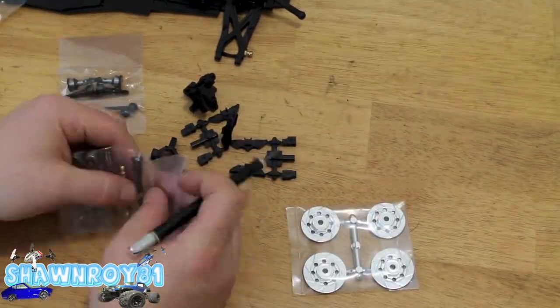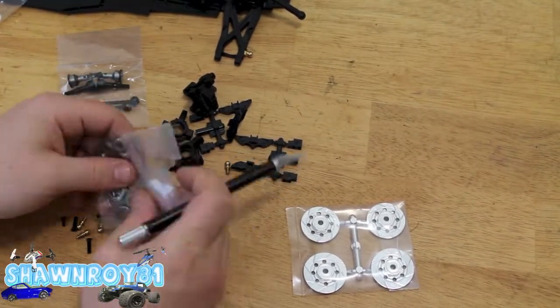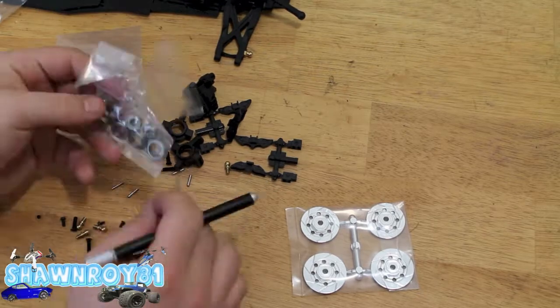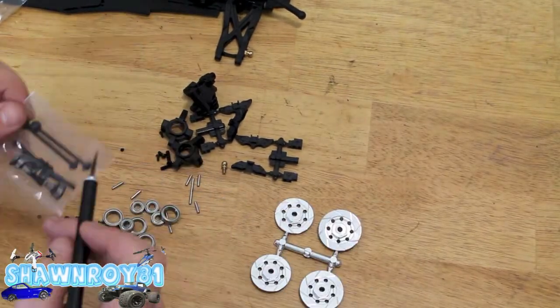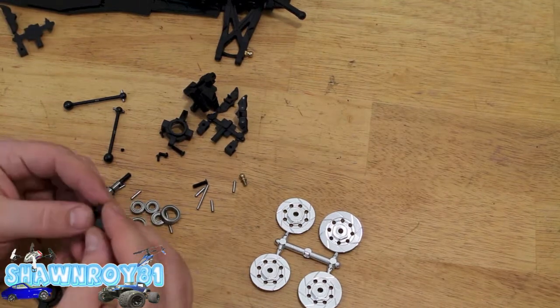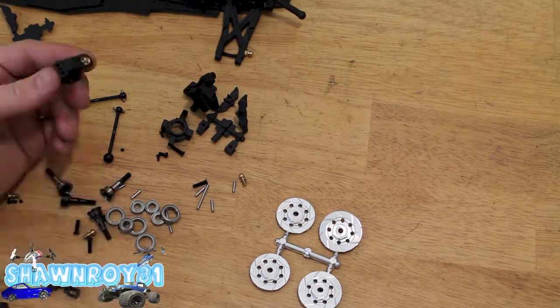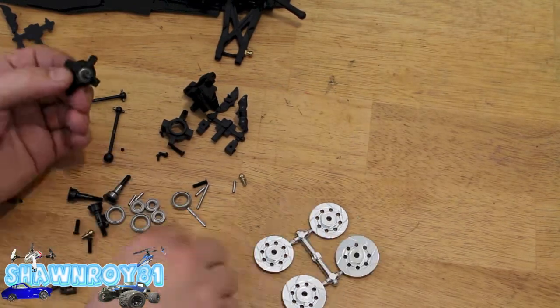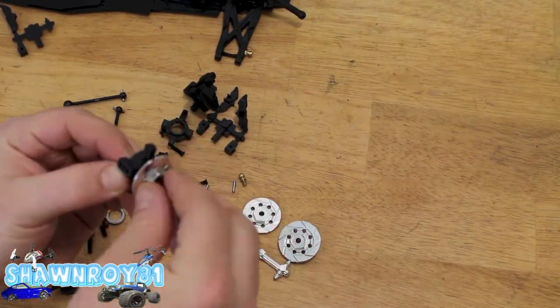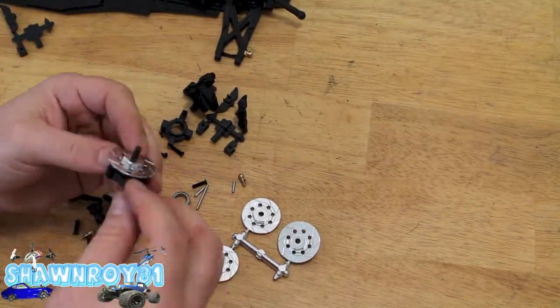And the caliper in this setup. Right. Load the bearings, get those discs off. So here we're just going to use a blank drive shaft because it's a two-wheel drive car. So throw that in, the bearings, and now for the disc. Alright, that's nice and smooth.